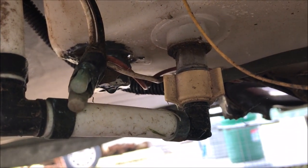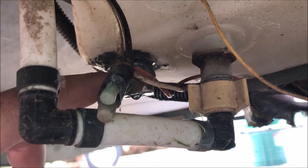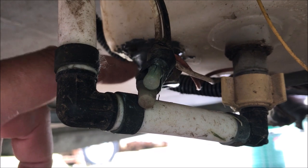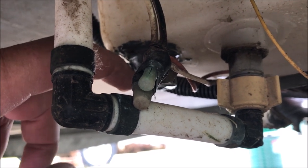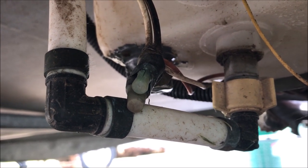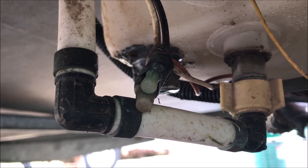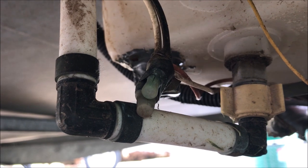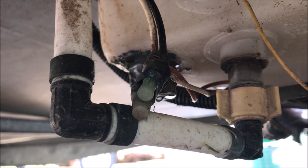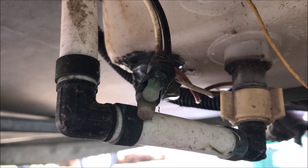The guy he bought it from had mentioned that it leaked down here somewhere and had put JB Weld on it. As I look at it right now, it looks like the leak might actually be between the plug and the threads. I'm going to use a knife and cut that JB Weld, remove the plug first. I might be able to just buy a new plug and put that in there. If not, I'll put the plug back in — since in my experience JB Weld doesn't work well on things that expand, contract, and flex because it's rigid once it sets up and will crack — I'm going to redo that fitting with Shoe Goo, and I'm confident that will stop the leak.